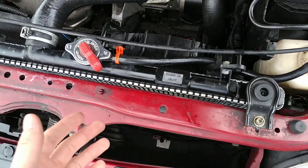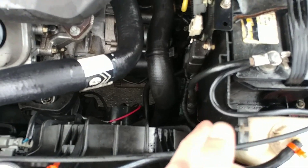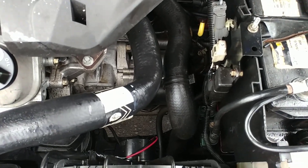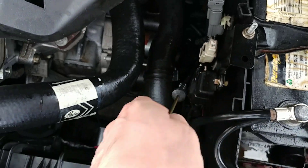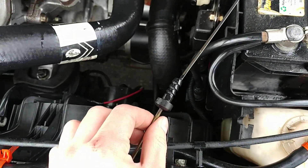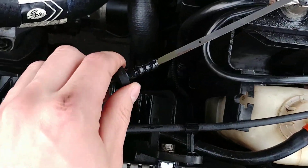What I ended up doing was replacing the radiator, and now it's not mixing anymore. I flushed out the transmission about six or seven times — it was a lot of transmission fluid — but I got it out. Now it's kind of how it's supposed to be, but there's still a little bit of excess water inside my transmission which is proving to be very difficult to get out.